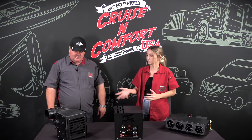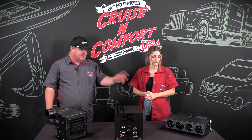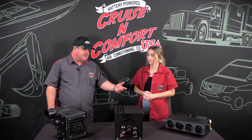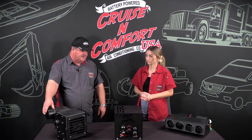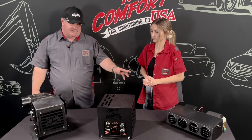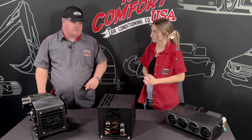The Icebox is 10,000 BTUs at 12 volts, while the Ultra is 8,500 BTUs. The lower BTUs on the Ultra are due to the lower blower velocity — the Icebox is 390 CFM where the Ultra is 280 CFM, so you get fewer BTUs and the compressor runs a little harder.